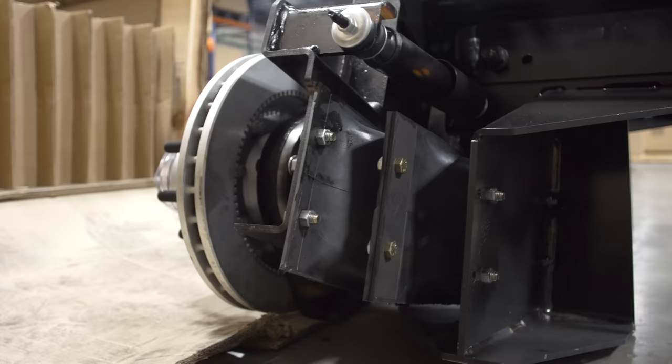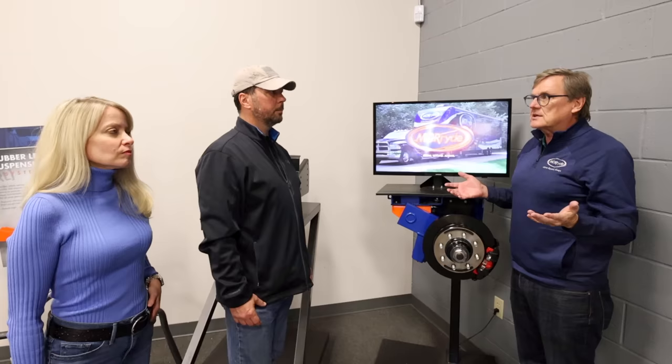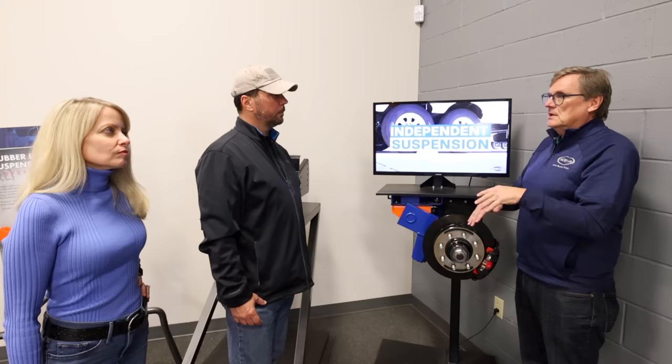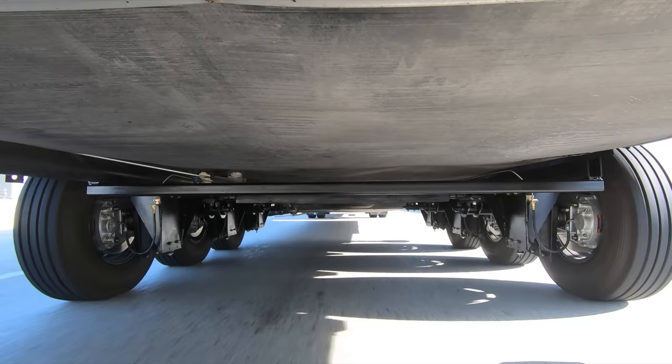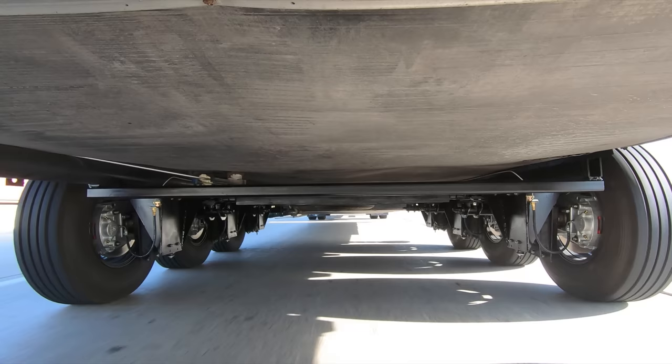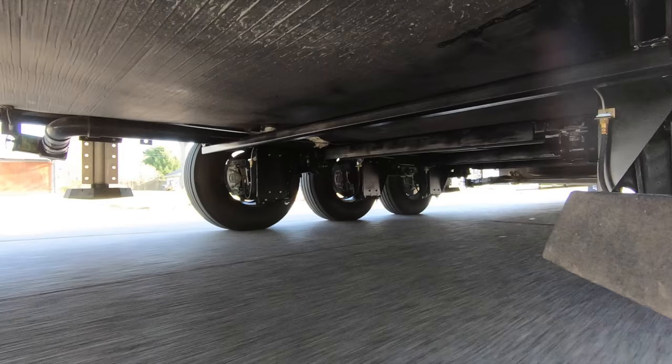The next thing is we use rubber because it's an isolator, it's an absorber, and it travels 5½ inches. Most leaf spring suspension systems travel 2 inches. So 5½ is much better — you can hit bumps doing this, or you can hit bumps doing this, and obviously this is much better. With 5½ inches of travel, rubber cushioning, and independent wheel action, we're literally able to walk over bumps that you would otherwise hit very harshly. The benefit in terms of towing performance is dramatic — greater up and down travel. That's what we've heard from a lot of you guys and we're super stoked to try it out.